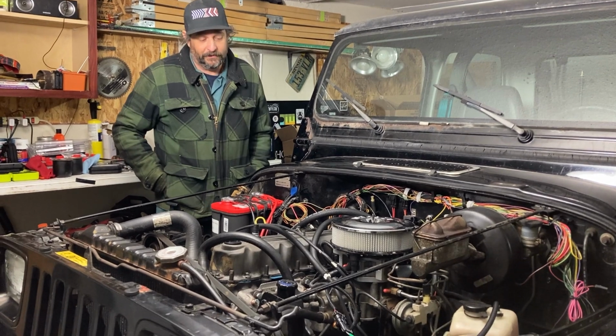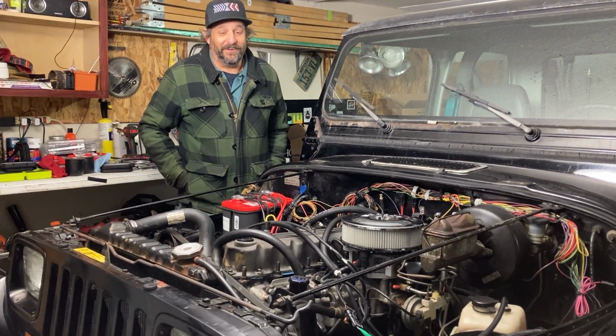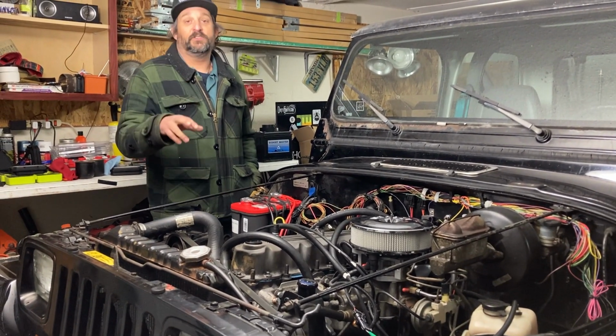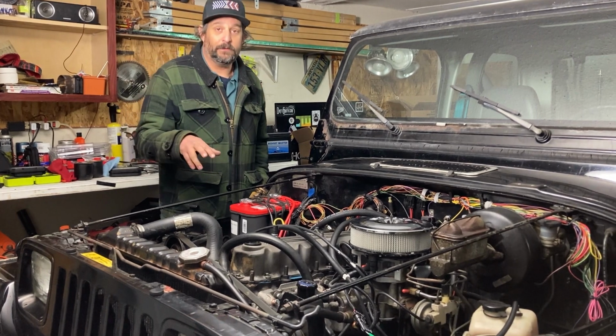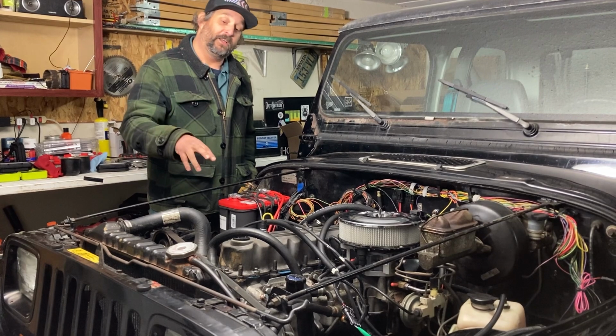So today we're gonna try to be a little smarter. We didn't advance the timing. In the instructions, they say advance the timing of 6 to 8 degrees. So we've done that now.